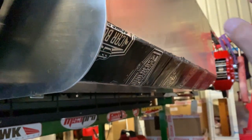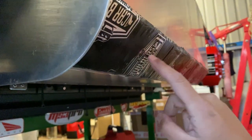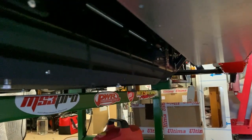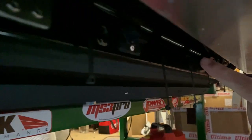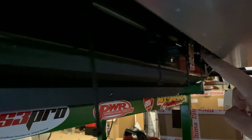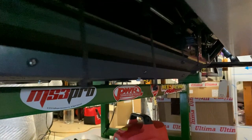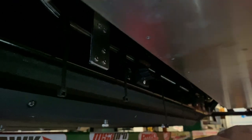Whilst we have the opportunity, I thought I'd show the side pod installed. There's a bit of sound insulation — some sound deadener — going on the side to add some mass to the side pod. You can also see where we're going to be running the wiring loom between the ECU and the back of the car. It's all ready to go with zip ties and appropriate clips. We're going to use rope to simulate the path for measuring out the wiring loom, and you can see it's going to feed back into the engine compartment between the fuel tank and the side pod.